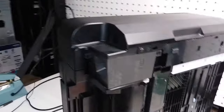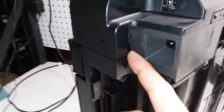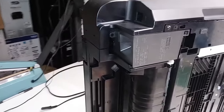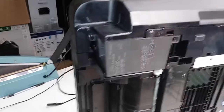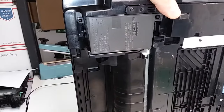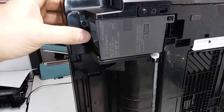So we have it on a different side now. This is where the power supply is, and it's usually just held by two clips — one is going to be here and one here. Sometimes, like the MX870 for example, it's going to have one screw in about this area that you just need to remove and then unclip it. Sometimes it'll be just one clip and one screw, but most of the time it's just a very simple process — you'll be able to figure it out as soon as you get to it.